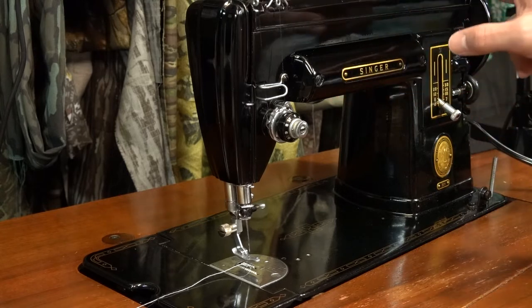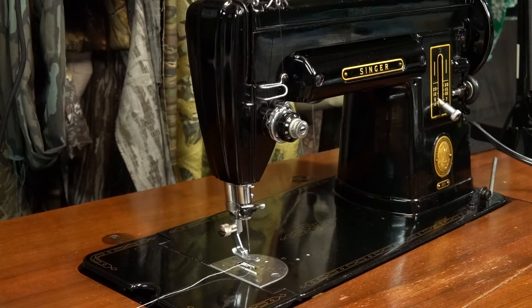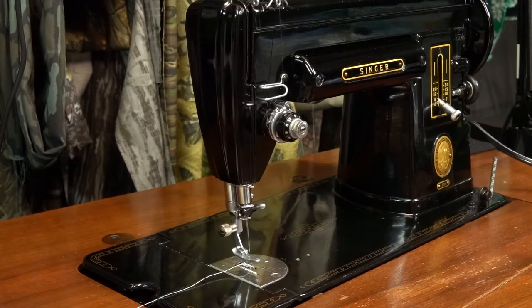You can take off the top of the machine and you can see the entire shaft, which is very nice. You can obviously open the faceplate and see all of the pivot points inside. And there is a drip tray on the bottom of the machine that you can take off and see all of the underneath — the cantilever shafts, the pitman arms, all of the pieces that make the sewing machine function. You can reach that stuff pretty easily, so it's really easy to clean and very quick to service.